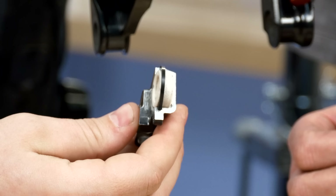Pull the clip, then remove the little screw. Now inside we have our pistons, but we need to bring them into the center. We do that by carefully pulling the brake lever. Let's clean this side first and then push that one back and clean the other side. You don't want to go too far, because if you go too far the piston will push out and there's fluid all over the floor. Do not let the pistons fall out.